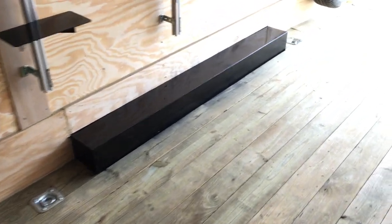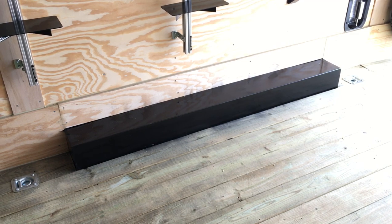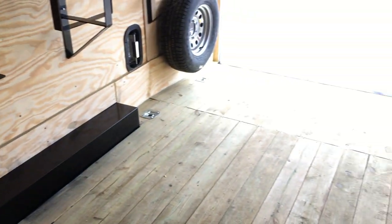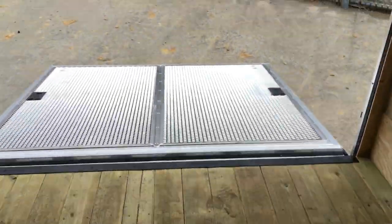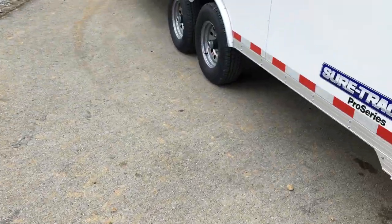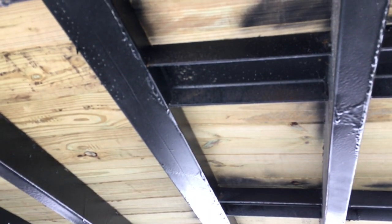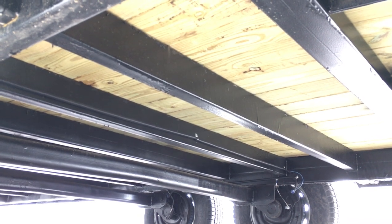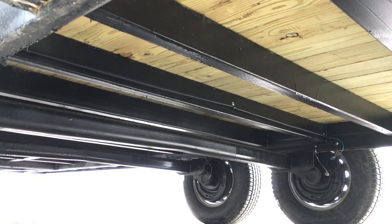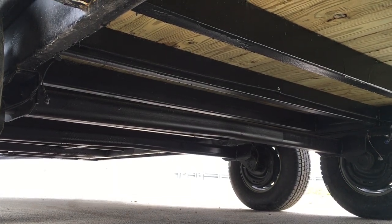Let's take a look at these fender boxes. Typically a fender on an enclosed trailer is about 11 inches; on this one it looks like probably five to six inches — you get a low-profile fender when you do the frame lift. Again, six D-rings, and another detail Short Track does: with their rings they use a nice steel backer plate underneath. It's not your traditional flat-steel backer either — they frame it out, kind of like a stake pocket. This trailer is also upgraded with torsion suspension, and it's got box tube floor cross members instead of typical formed cross members, which makes the floor studs much stronger — actually in many cases heavier than what you'd see on a 14,000-pound dump trailer floor.